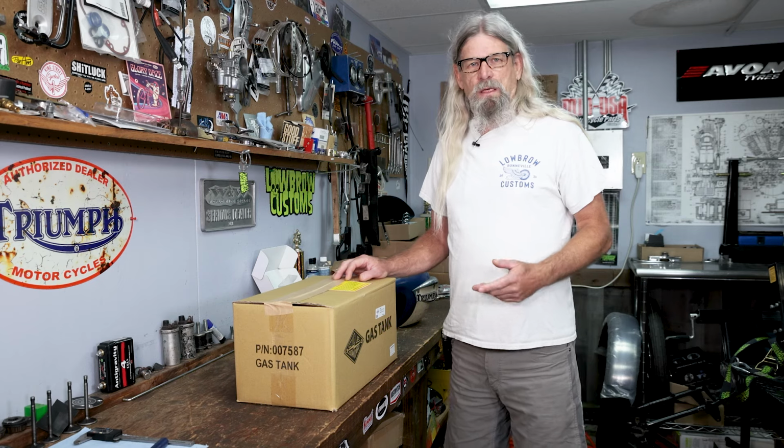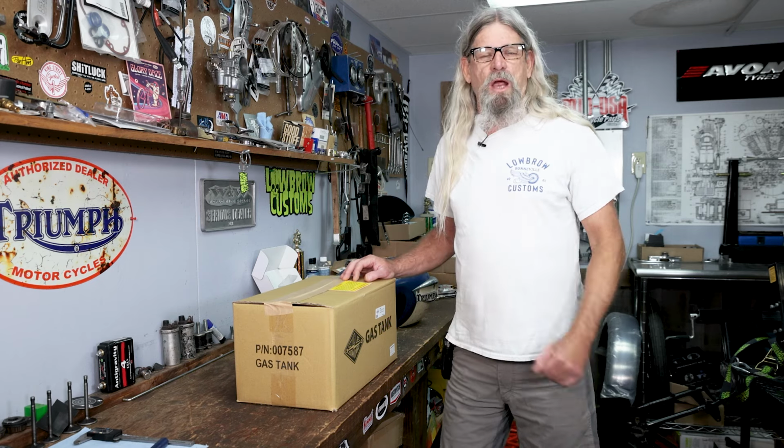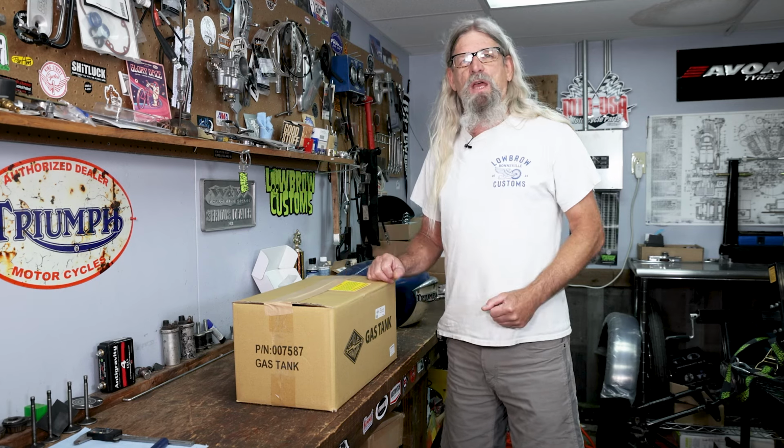But what I do tell them is, go to the kitchen, take Dawn dishwashing soap, and put a little bit of that in the tank with a little water and slosh it around, clean it out real good, rinse it out a couple times, and then, I know what you're thinking, you just put water in your tank and it's gonna get rusty. Nope, dry it out with a hair dryer, or if you've got a heat gun in the garage, dry it out real good. And the reason I'm telling you to do that is because there might be some oil, there might be some residue from the manufacturing process, whatever. You want the inside of the tank to be clean before you put it into service. Do you need to seal it? I really don't see any reason why.